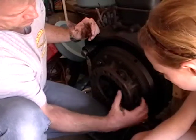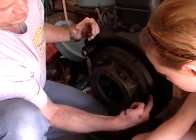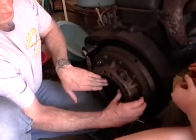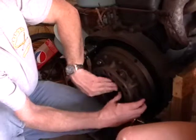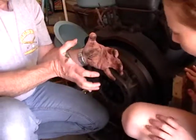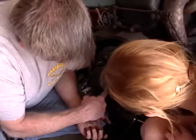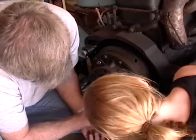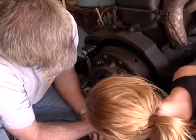So it makes it stop. No. These bolts are actually connected to the clutch plate, which is down inside of here, and you can't see that right now. What that does is when these tangs all press in, it pulls a plate out like this. And if you look in here, see these giant springs? Mm-hmm. This is the plate right here that those screws are attached to.